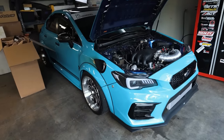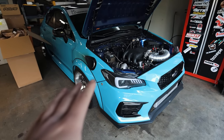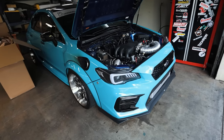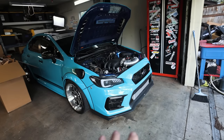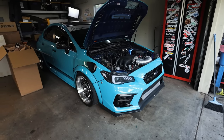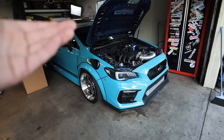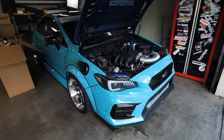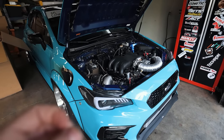For this little princess here, I have an AccuSump on the way that I ordered. It's a 2-quart AccuSump that we're gonna have to find a home for, and feed it to the engine with a dash 10 feed line. And all the AccuSump is gonna do is keep 2 quarts of oil in the sump and it just regulates pressure with the engine. So if the engine goes down in pressure, it'll push oil into the engine to bump pressure back up. And as the engine comes back up in oil pressure, it'll push oil back into the canister. So it's not 100% fail safe, but it is a precautionary thing to have installed in there.